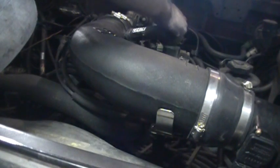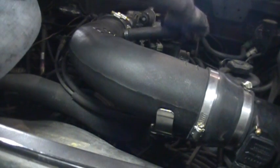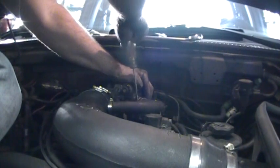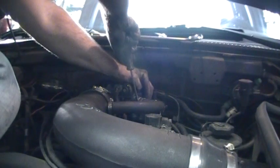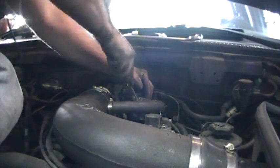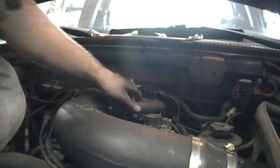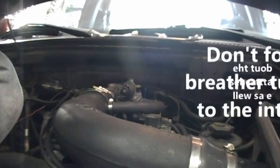And now after that, we're going to put in the tube that connects the idle air control motor to the intake tube. So next we've got to do up the two hose clamps that connect the idle control hose to the air intake tube. If you leave these loose, then you're going to get a vacuum leak, and because this is a mass airflow controlled motor, the motor's going to run like crap because it's getting what they call false air. So it's getting in unregistered air that isn't measured by the mass airflow sensor. So it's very important to make sure all the coupling fittings are tight.